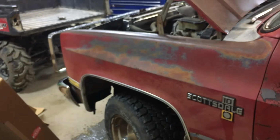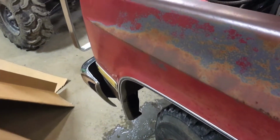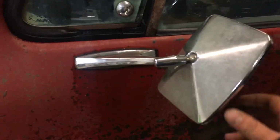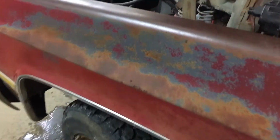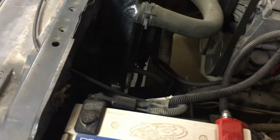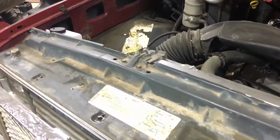And I hope the beginning of this video doesn't suck too bad, but I just got to give her a good once over. I got some stuff I got to hook up, just odds and ends, and I got another set of mirrors I'm going to put on it, because obviously this one's junk. But yeah, just got some little stuff to do to her yet. I got to finish hooking up my dome lights. I got to check all the fluids. I got to let it actually set and warm up so the transmission gets up to operating temp, so I can see where the level is.